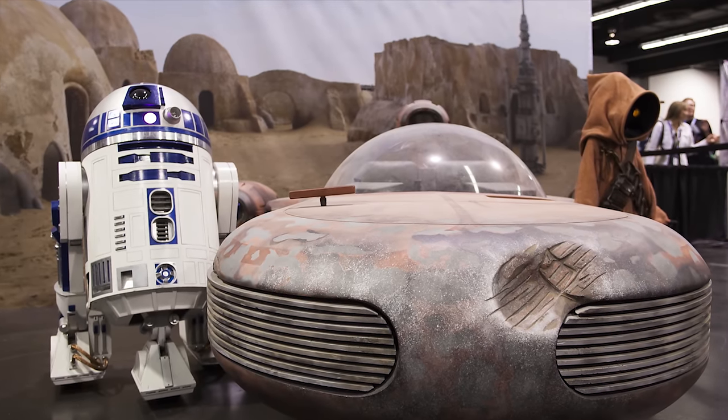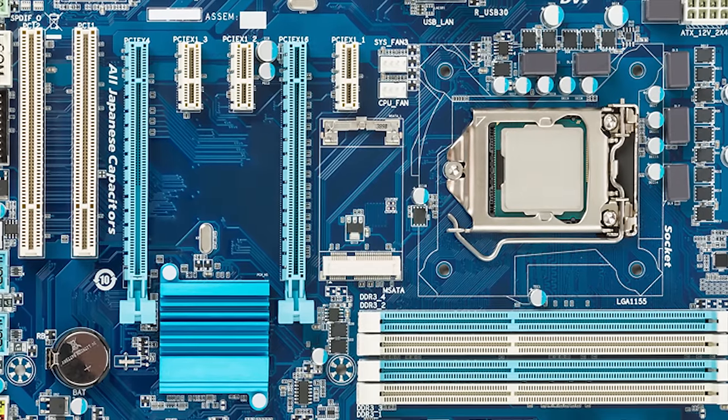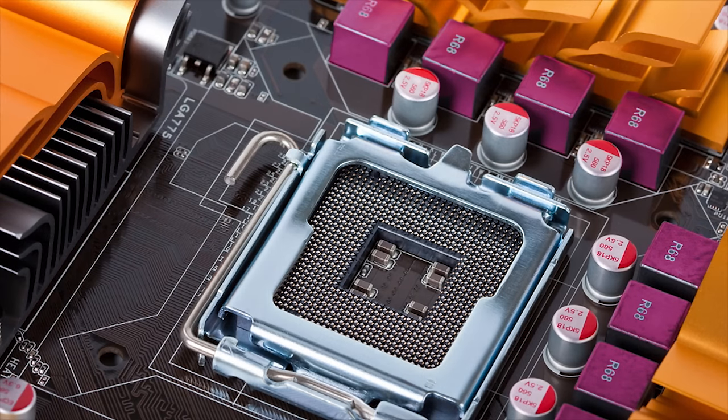So how do you know what to look for? A couple of simple tips can help you make sure you don't end up having to make a long trip to the Tosche station to pick up a replacement power converter. One of the easiest things to do is just count up the number of chokes on the motherboard. Motherboards split up power delivery to the CPU into a number of phases, and more phases means the power is split more ways, lightening the load on each phase, which in turn can lead to greater stability. Each choke on your motherboard corresponds to one power phase, and usually all but one or two of these around the CPU socket are reserved for your CPU cores. Entry level boards will usually have three or four phase CPU power, but higher quality boards can have six, eight, or even more.